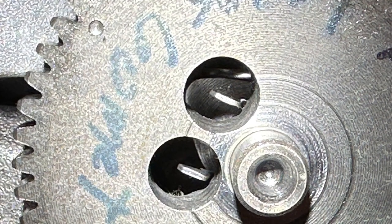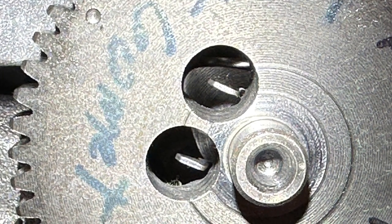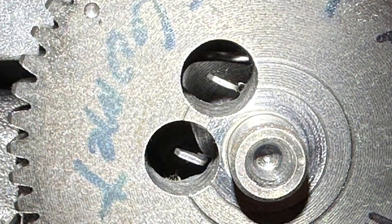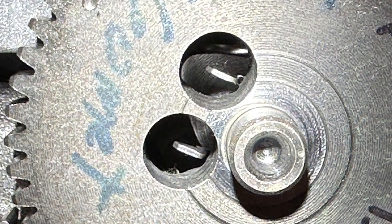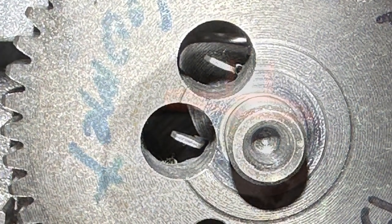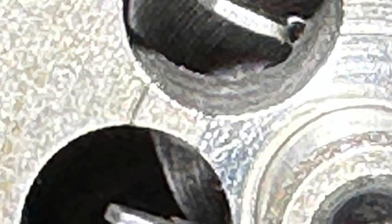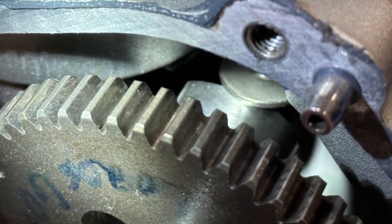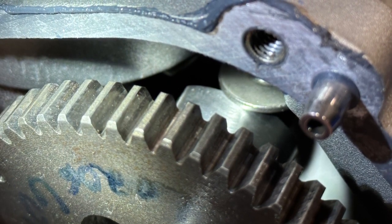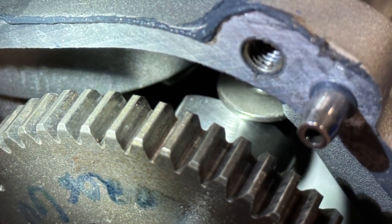Here's a closer look at the cam and we're looking through that upper hole. You can see the lobe of the cam and that shiny spot is the lifter that's resting right against the flat or the flattest part of the cam. That's where you're going to lock this cam down and you'll be able to twist it at this spot. Through the upper hole, we zoom in and you can see the lobe of the cam. I've highlighted the lifter in red so you can see where it is and how it's sitting flat on the cam shaft. Now I've pulled the cam away just so you can see where the lifter is riding on the flat spot of the cam. This just gives you a different angle or perspective since it was hard to see through the opening.